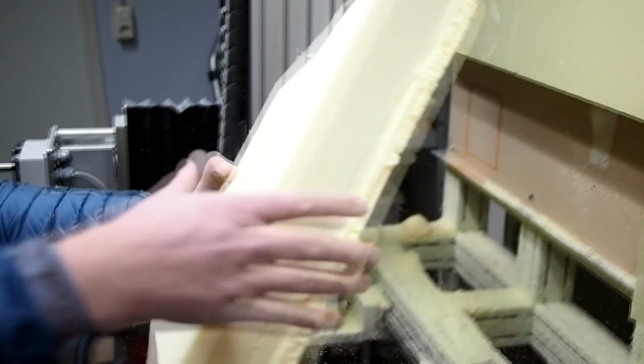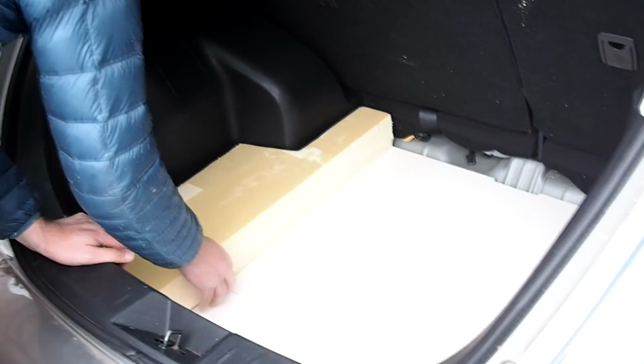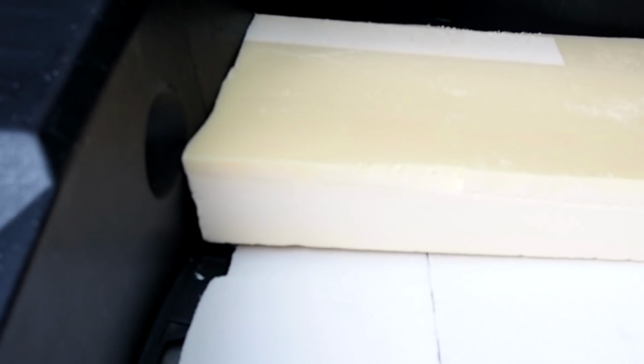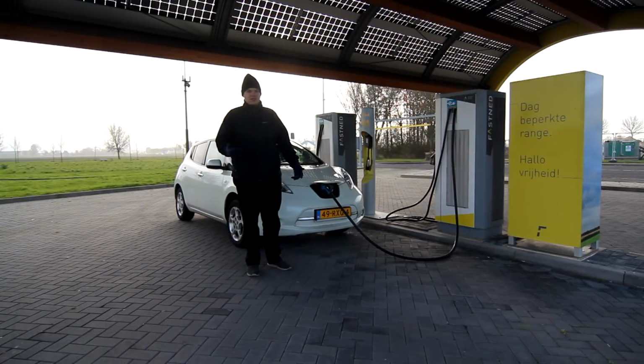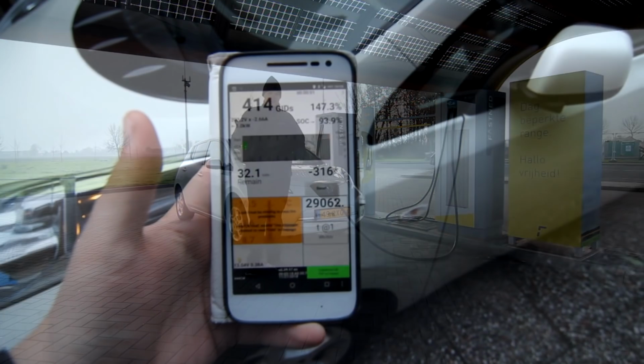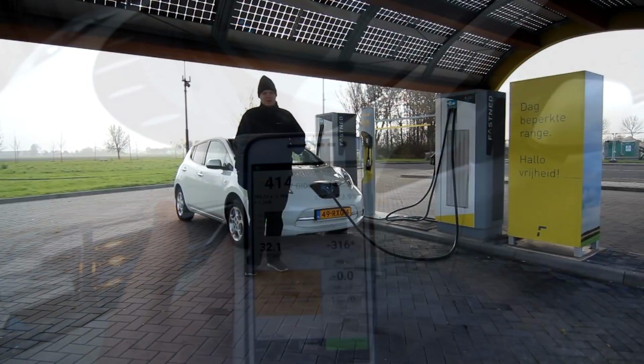The hardware might work, and I have the main drivers, but a lot of the functionality has not been implemented yet and has not been tested yet. So, for instance, right now in my car, I have what I consider to be the MVP, the minimum viable product for the CAN bridge. This is the PCB that intercepts data from the battery to the rest of the EV subsystem. It adds up the capacity of the main battery and the extended battery, puts them together, and that's what you get to see. That's what you see in Leaf Spy as well. But the kinks haven't all quite been worked out.